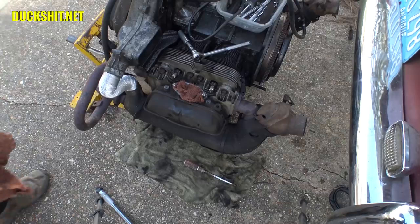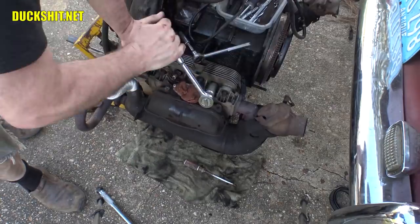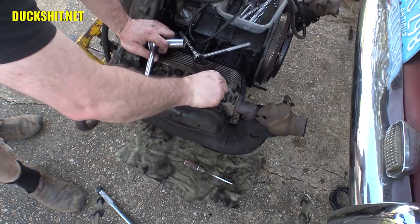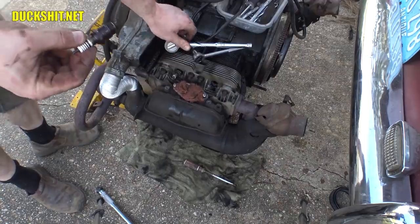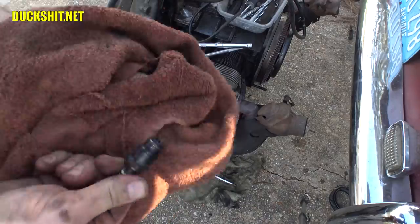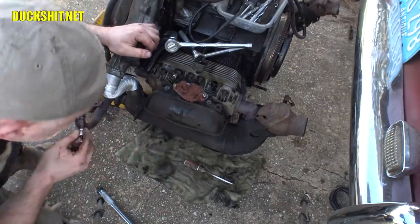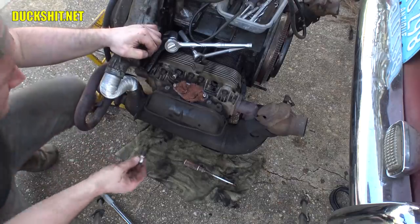All right, let's attack that spark plug next. All right, see what we got in here. Feels normal as I'm threading it. There it is, it's out. Yeah, okay. What do they call that damn nut thing that screws into a cylinder head when somebody stripped it out? Somebody must have re-drilled the hole to the spark plug and didn't do it straight. Yeah, that's what it looks like. The threads don't look like they're messed up.